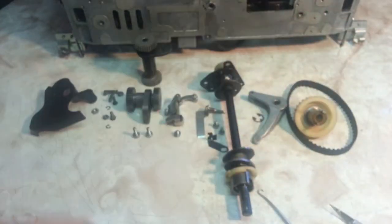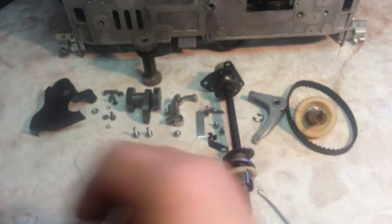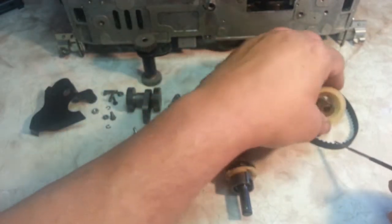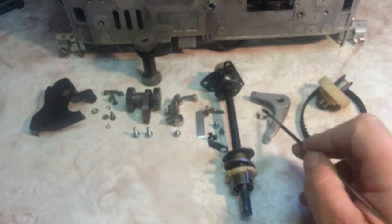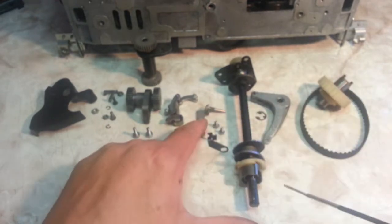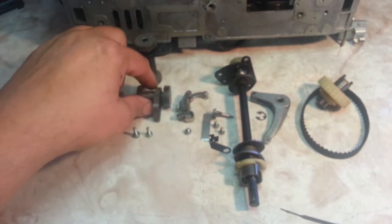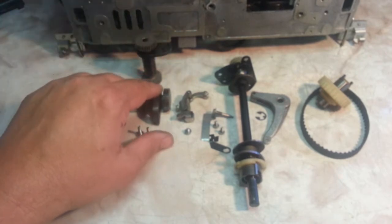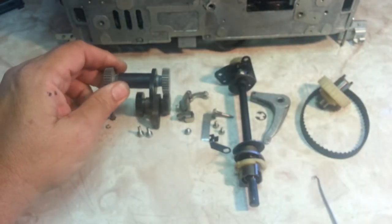Okay, that's ready to go in. So we're going to have the pulley going first, belt goes in next, swing arm goes in next, retainer clip, operational shaft with the clutch, all the retainers, cycle clutch trip, retainer, gear pack. By the way, this is a 13 inch model and it's got a smaller gear pack than the standard 15 inch — same deal but shorter by 2 inches.